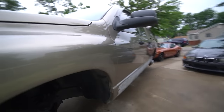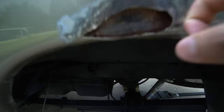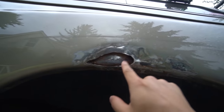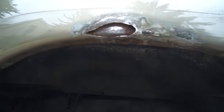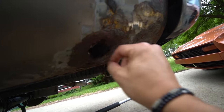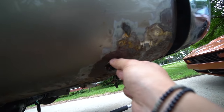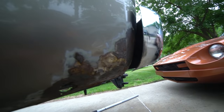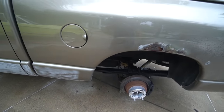The issue is this part — when I was sanding it down, the rust was so bad that it just ate right into the fender. What I'm gonna do is POR-15 this after metal etching it, and then once the POR-15 dries I'll fiberglass over it like I did with the race car. I'm probably gonna do the same thing with the hole down here — to prevent water and salt from getting in I'll lay fiberglass there to seal it up. Then I'll etch it and lay down POR-15.